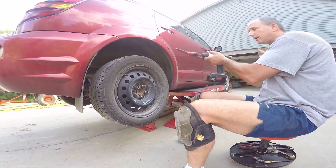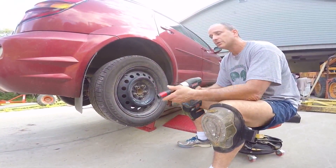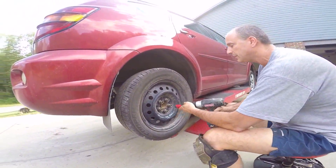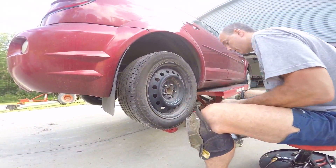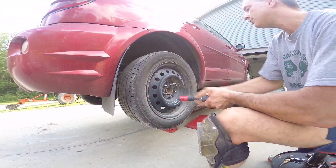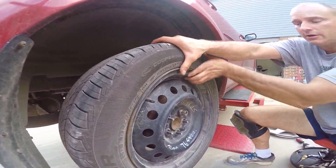I'm going to go ahead and take these lug nuts off. Another little tip — I don't have an air compressor set up right now, so I just put a quick chuck in there with a little cordless drill and it speeds everything up. Let me thread one nut on and give it a spin so you can hear the drag.